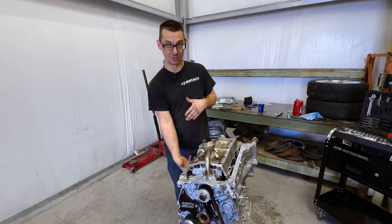Let's move on to the unboxing and hoping that we have an oil pan gasket. We got a couple catalogs and stickers. There it is — oh, that fits pretty nicely. This is the oil return for the turbo already welded in, just capped off on the backside. I believe this one you can use for an oil temperature sensor. On Honda oil pan gaskets, people put a lot of RTV, but you're really only supposed to put it where metal meets metal — so there's four spots front and rear.